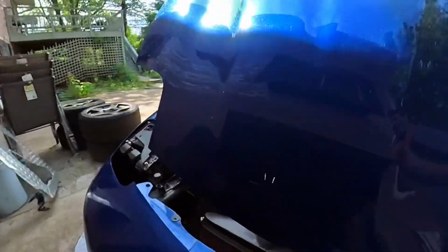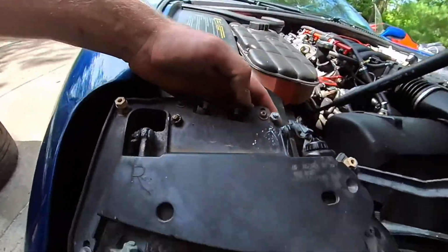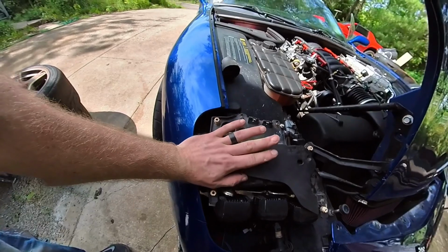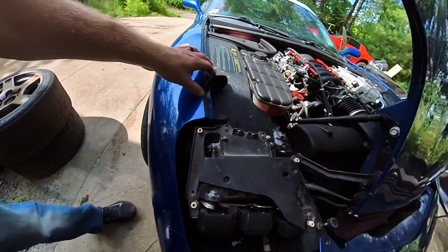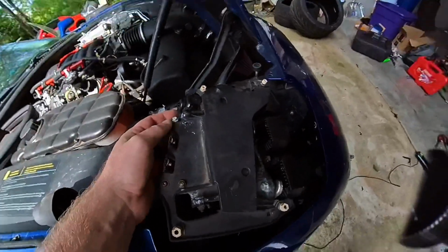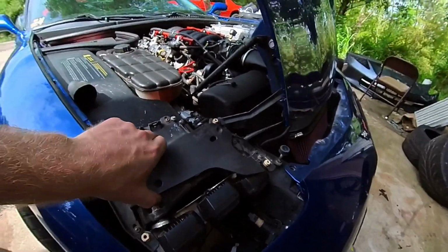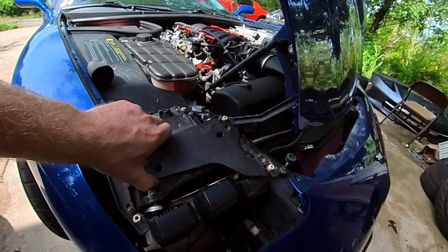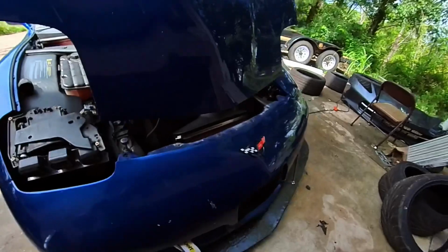So basically what we're doing here is, with the stopper in the back and then the hammer inside of here, all that's doing is telling the motors when to stop, and then it stays placed with the motor stopped. And you want to have this backstop on here because if not, your headlight will shake while you're on like a highway or things like that. So that's how you know for sure if you don't have them lined up: it'll start to vibrate a little bit. But once you have them lined up between the adjustment screw inside and the back here, then you'll have them pretty stiff.